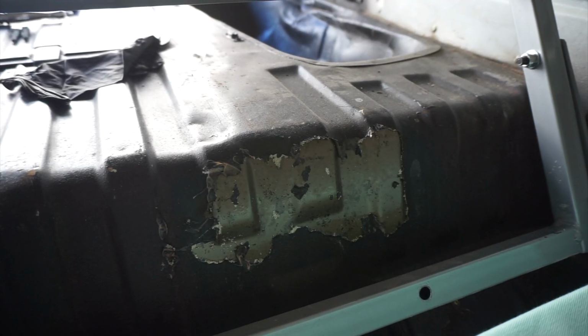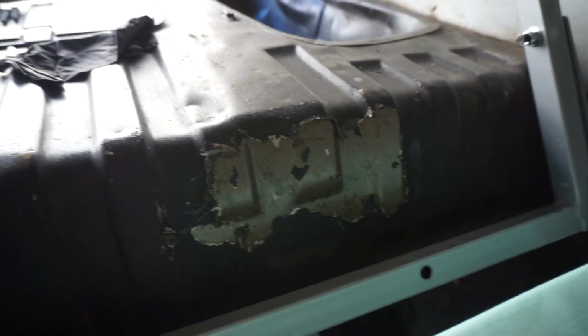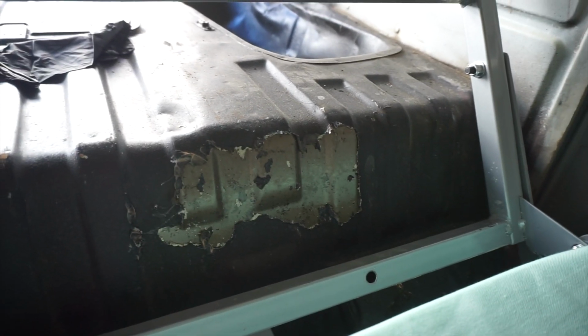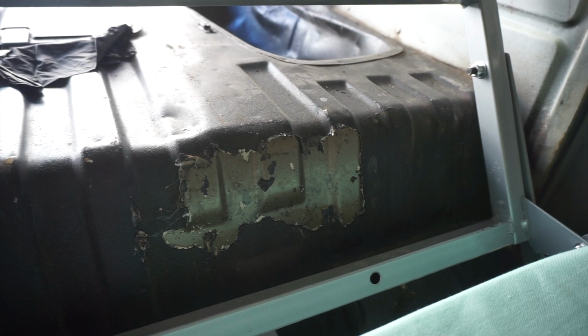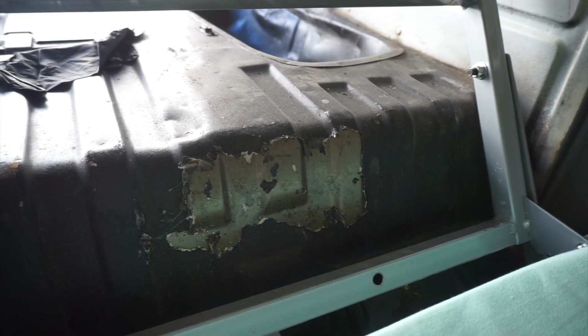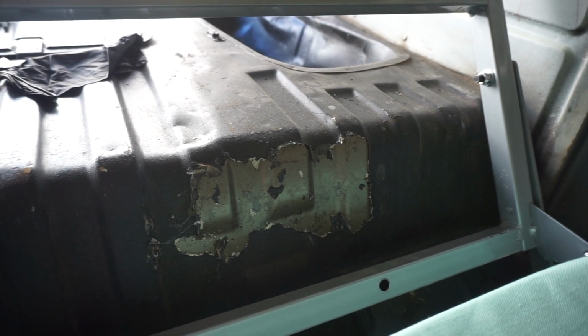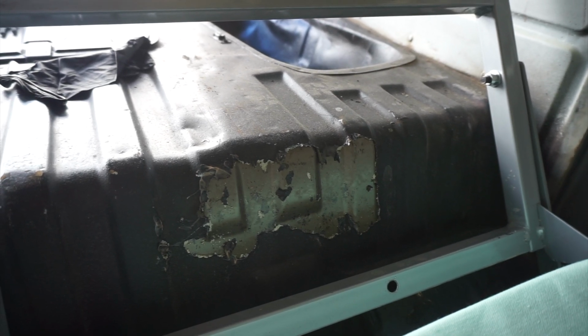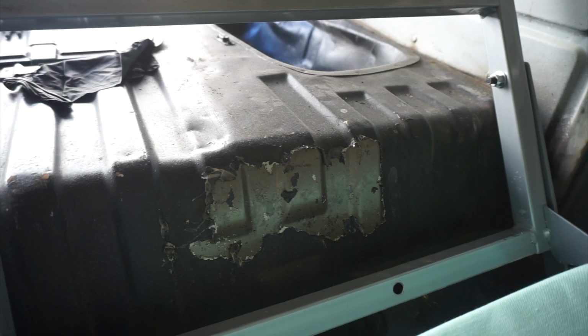Okay, I'm going to weld a little bracket here on this spot, spanning 3 of the ribs, which is just about 7 inches on the dot. So I'm going to cut some steel L-channel and weld that on there, and then that will catch the bed as it folds down. I removed the rhino liner there using citrus strip overnight, and I'll go into more detail with the body floor panel repair video.